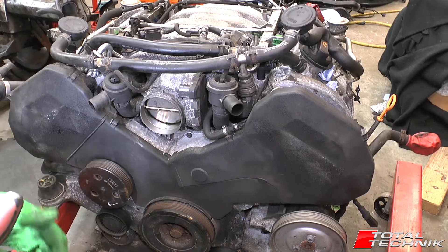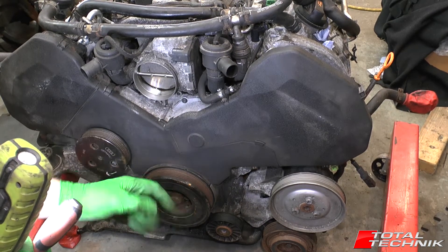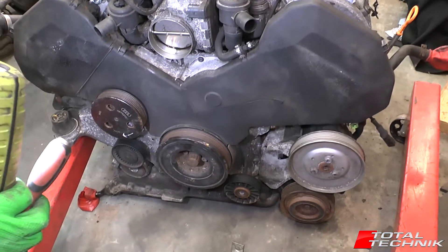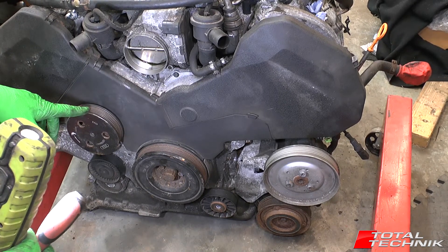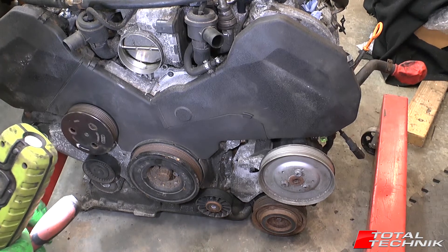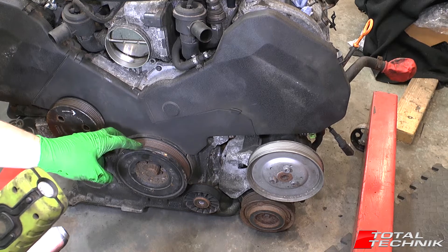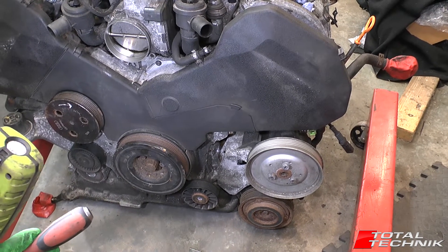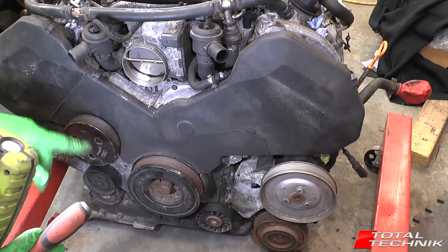Quick peek at the front of the engine. This is literally what pokes out towards the bumper — your radiator and everything is almost directly in front of this with a very small gap. So when you peer down and see the belts moving between the engine and the radiators, this is exactly what you'll be looking at. All these pulleys dotted around here are nothing to do with the cam belt — these are the auxiliary stuff. The auxiliary drive belt feeds around these, driving your alternator, your air con system, and things of that nature. Your main crank is this one here, and you have to manipulate that to separate the engine and the gearbox, as shown in that video.